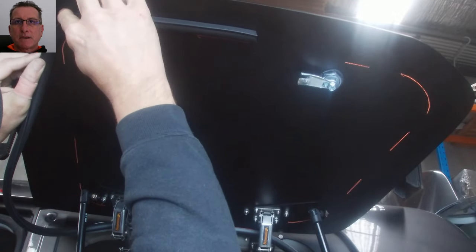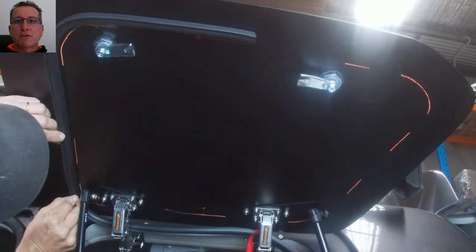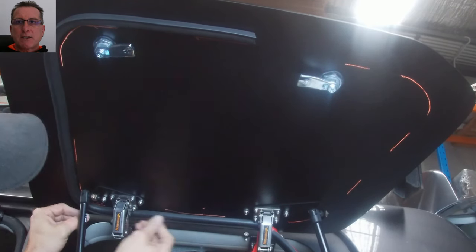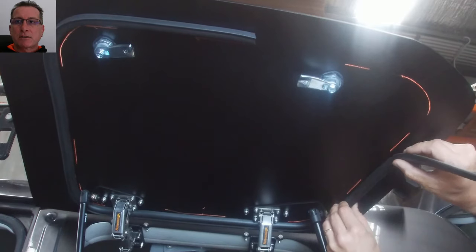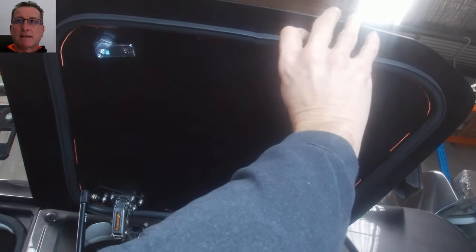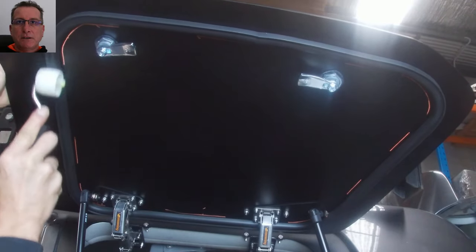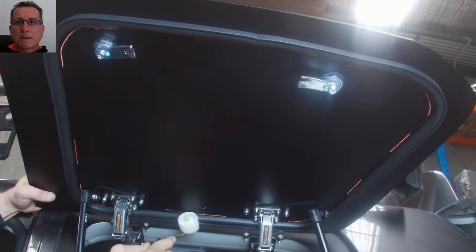Starting at the bottom centre and just following outside of my chalk marks. When you get to the top of the panel you actually want to really tighten up on those chalk marks — we want this rubber as close to the hinge as possible at the top to prevent rolling. I'm actually sticking it exactly where the face plate meets the door panel. I'll also make it a little bit high between the two hinges — just a millimetre or so — just to improve water runoff. Continuing around, spaced out slightly more from my chalk marks, and coming back to meet in the centre. When I cut this off I just over-cut it by two or three millimetres and then tuck it back under — this gives a really good meet point. Then coming in with a roller to ensure all the air bubbles are out from underneath the glue and tape, making sure we're getting a good bond to the door panel.